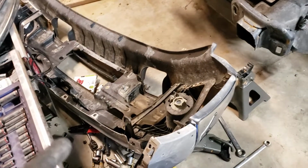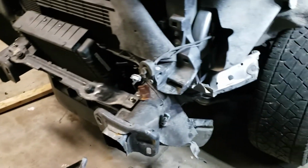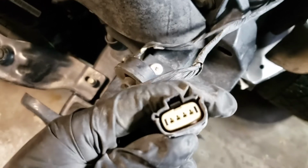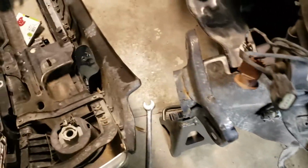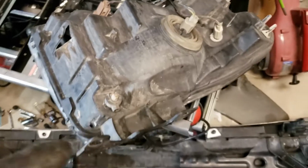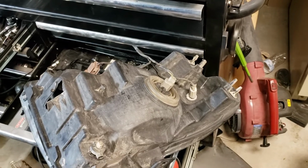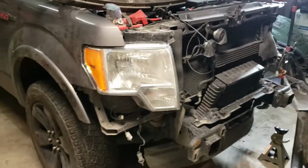All right, everything is unloaded. I put the headlight on that side. It mounts up fine, but I'm pretty sure that it will not plug and play because these models have this terminal 4-prong for the headlights. And on these, they only have 3. So to get my headlight working, I might just have to wire in a relay that comes on with maybe the parking light, because those are the same. But yeah, it's going to make it look like just a normal F-150 with those headlights.